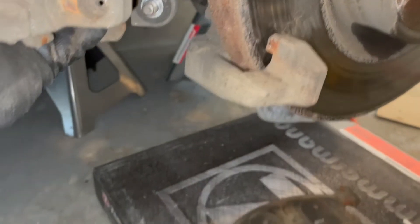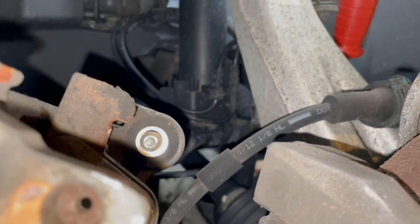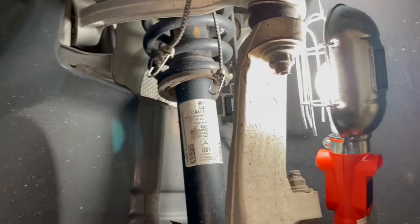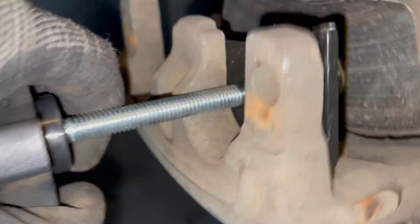So now I'm going to take the caliper off — one of the brake pads just fell. I don't want to damage the brake line, so I'm going to hang the caliper using the bungee, looping it through and over the coil spring. Once it's propped up, we're going to use our caliper tool to push the pistons in even further — flush them, working them back and forth side to side until the pistons are fully flushed. Walk those pistons all the way back until they're pretty flush.